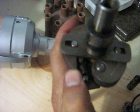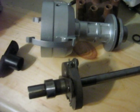The other thing distributors have here is you can see you've got some counterweights there — it's centrifugal advance or mechanical advance. I'm going to retain that, so this engine will have spark advance as it revs up.